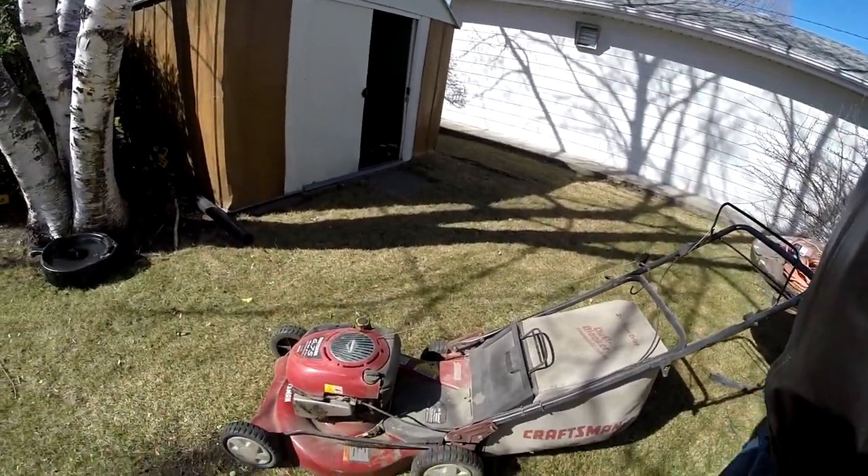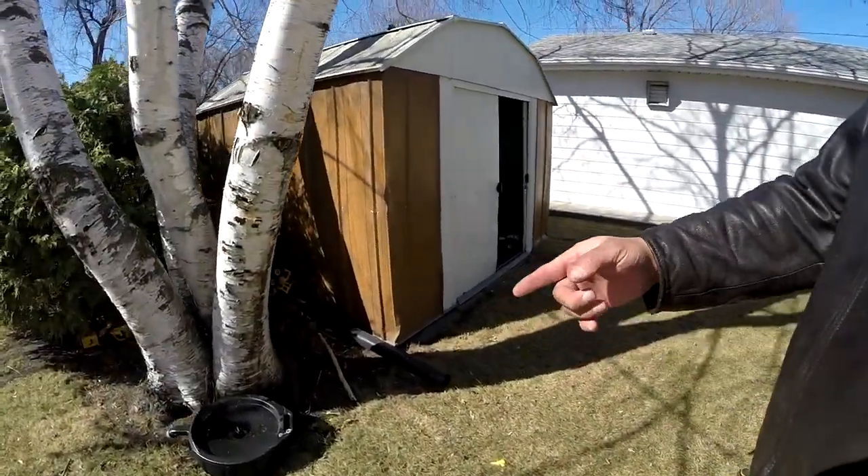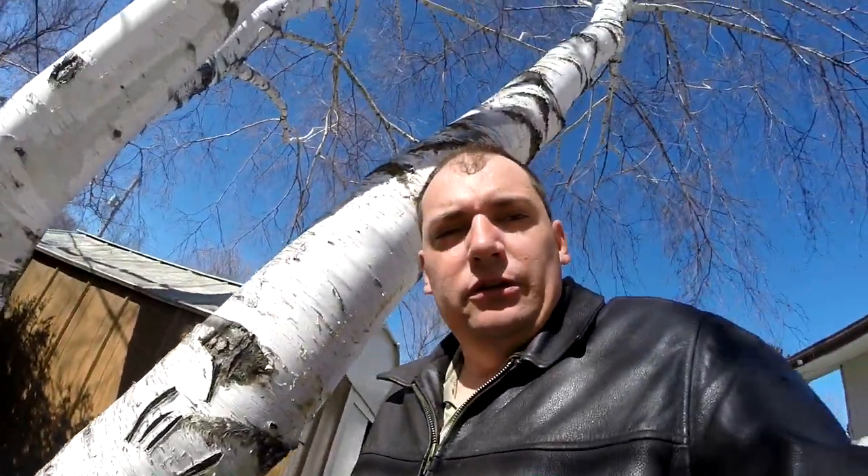Good morning and welcome in everyone. I am at home today and I went and grabbed my lawnmower out — I'm gonna do an oil change on it. Got me some tools over here and all that good stuff. So what I'm gonna do is take the spark plug out, probably go to Canadian Tire up here and see if I can get a new spark plug, and I already got an oil pan over here to drain all the oil.